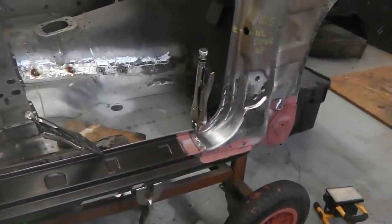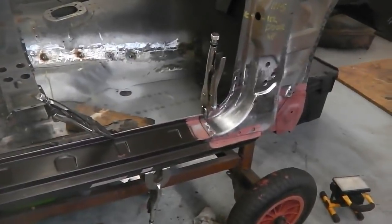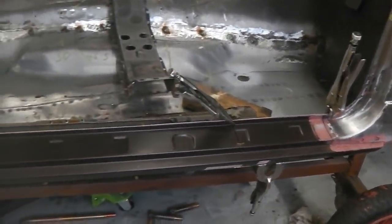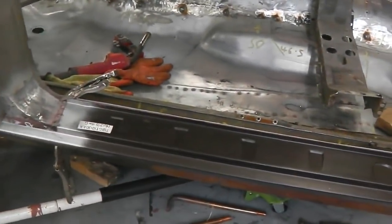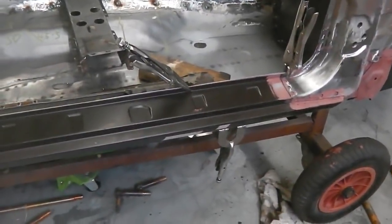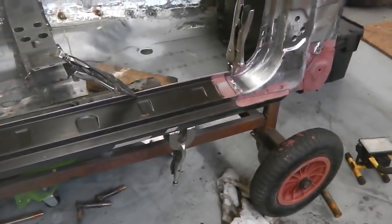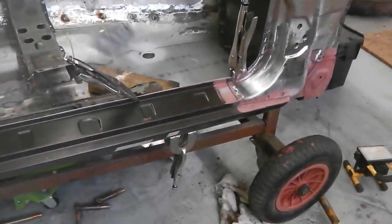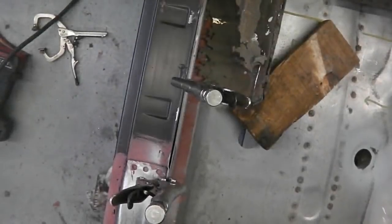It's the original door. We have got other doors off the Portuguese shell, but we're going to use the original doors for the alignment. Okay, so I'll get some plug welds in, and I'll get some spot welds in along the top. Just see how the spot weld takes. Here we go. Going good for inner and outer sills.